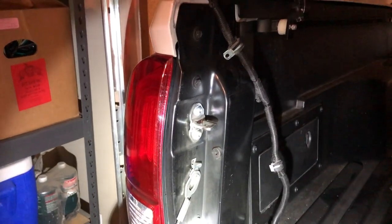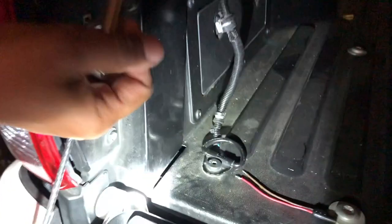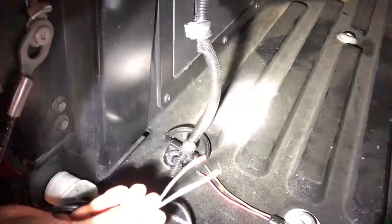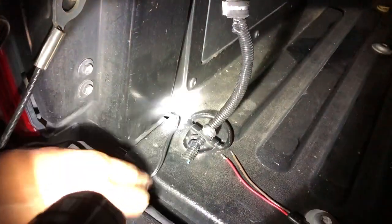Step one: to gain access to this taillight, you're going to remove three 10 millimeter bolts down here, and essentially this taillight is going to fold out. While my dad is doing that and tapping the brake light wire, we'll show you the process. We're going to run this connection down here into this hole where you can see the light peeking through that little hole in the bed. What's going to come through is going to be this standard SAE connection — you're going to see these bare wires go down in here and wrap up and under and into the space where the taillight is mounted.